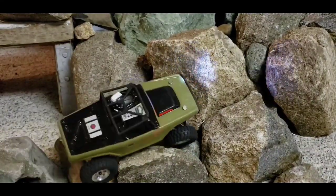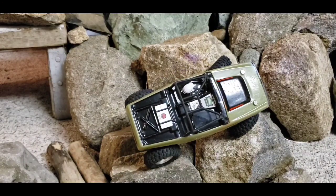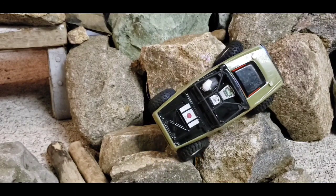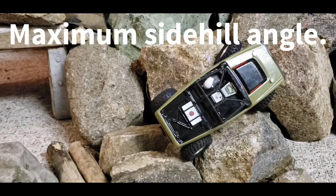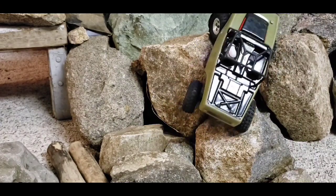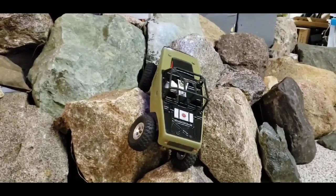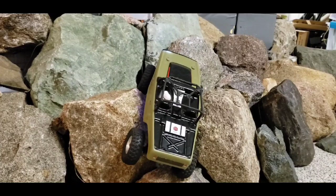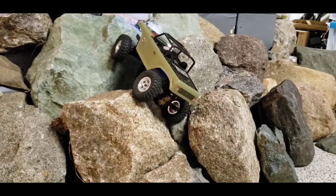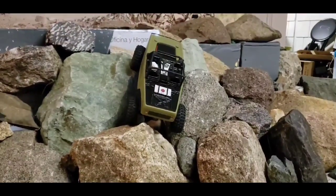These are slightly taller. And I've not made it with these tires yet because I haven't fully tested them yet on this path. But it's pretty tricky because it's heavily leaning, a big side hill challenge there. One thing that you'll notice with these tires is the back end does not slide around. When the front hooks, it just turns the whole truck, because these tires have so much grip that they just don't slide around corners, where the fronts on the Patagonias can kind of just drag the backs around and they'll do what they need to do to get dragged around.